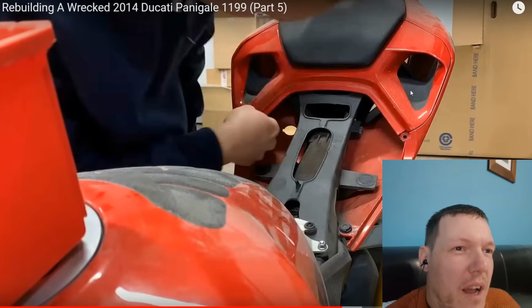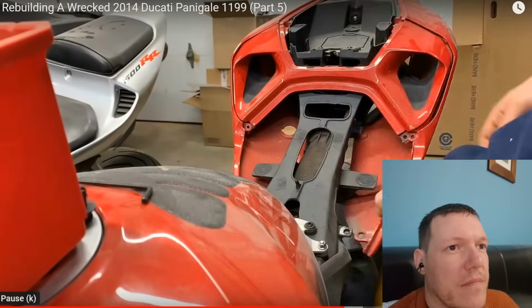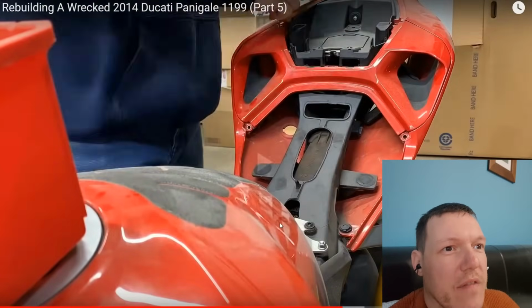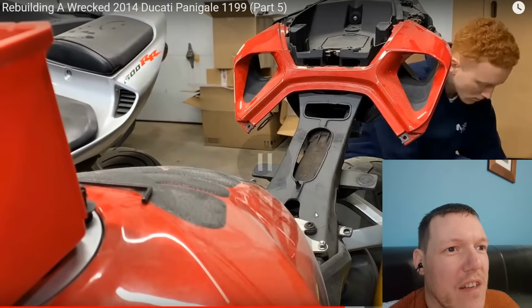This whole tunnel idea is a good way of removing form drag completely, because you take what would be solid and turn it into a thing that air can just pass through. So that's cutting form drag an awful lot. But if you did that and took all the fairings off and just learned to sit on this bit, and made a little diamond shaped pad, it'd be even better.